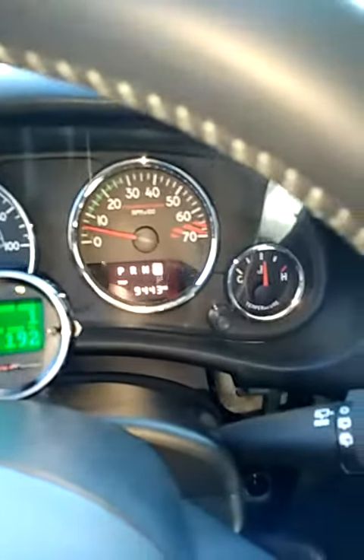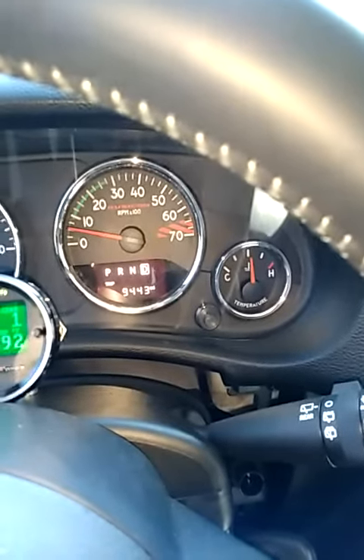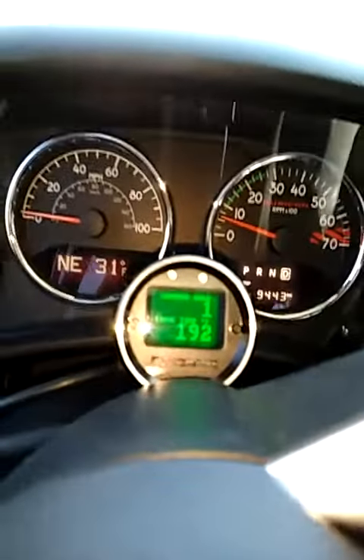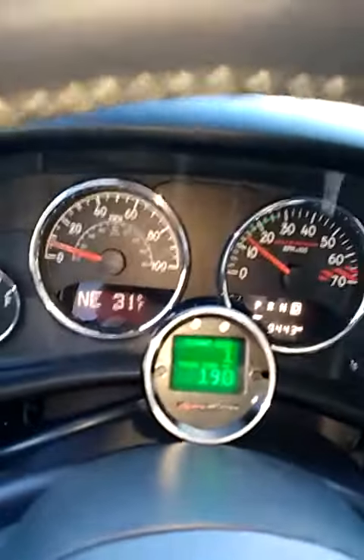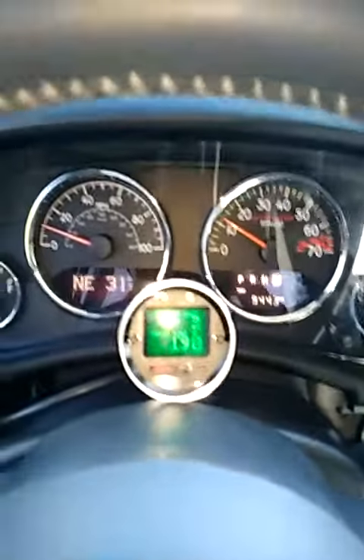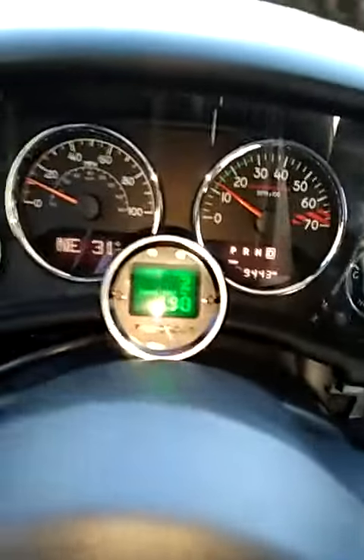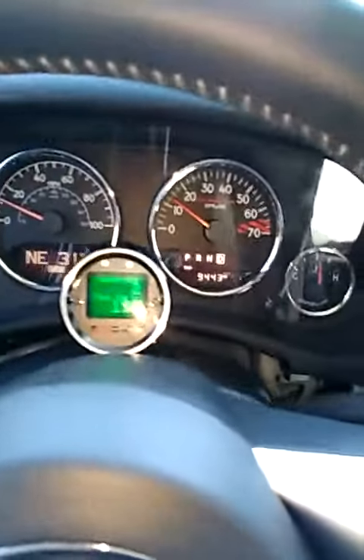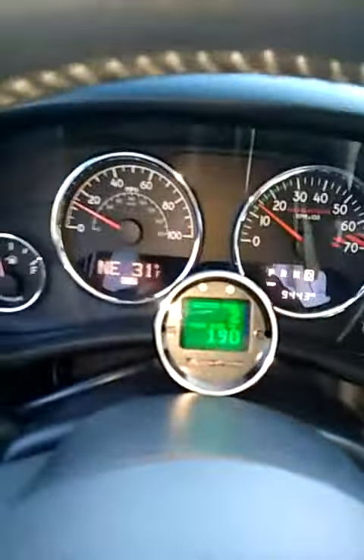Let's go into drive. We can lock it in first gear by moving into the manual gate — we don't have tap shift here, but we are locked into first gear. Now I can bump up into drive, let it upshift, and bump back into the manual gate. Now we're in second, so we've locked it into second gear. You can literally lock it in any gear you want with what I call 'gear lock.'